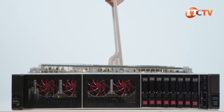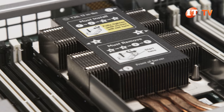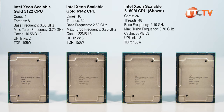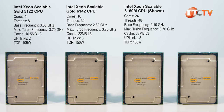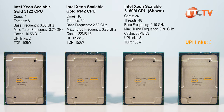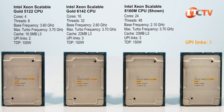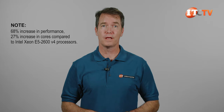Configurations for this system include both dual and quad processor configurations using Intel Xeon Scalable Gold 5100 or 6100 processors. If you're going with only two processors, go with the Gold 5100 series. Or you could go with four of those ridiculously expensive Platinum 8100 processors. Top-of-the-line Scalable processors have three UltraPath Interconnects, or UPI, per processor for vastly improved inter-CPU communications, plus gains in performance and cores, and reduced power draw over the previous generation.